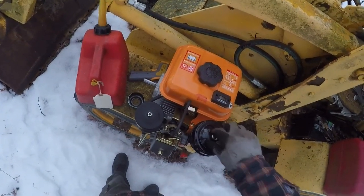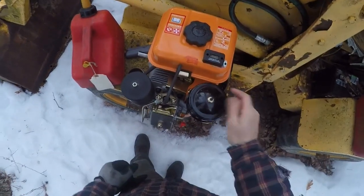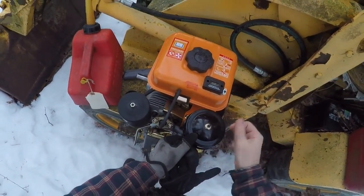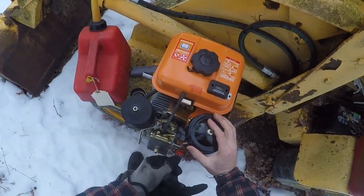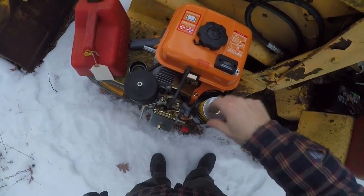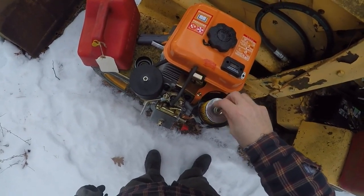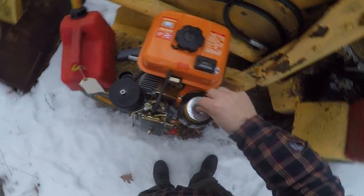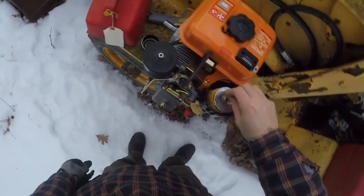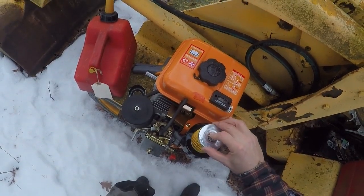This particular engine gives us the ability to do what I like to call an improvised thermal start, because its intake is constructed of steel, and this allows us to actually get to the point where we can try another technique that most people probably don't bother doing or are unaware of. And in order to do this, we want to remove any elements that could be subject to damage by adding heat. So we'll want to remove that air filter element.